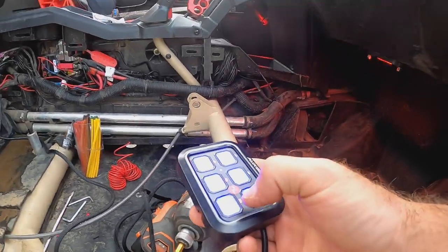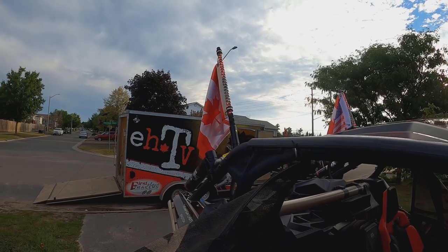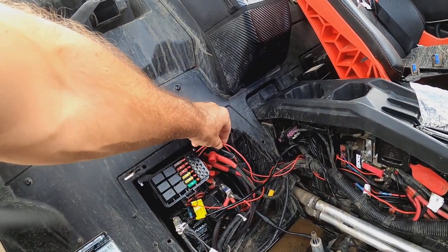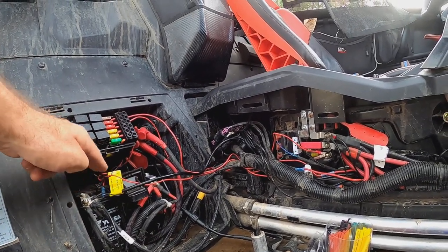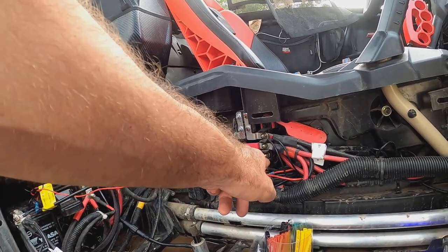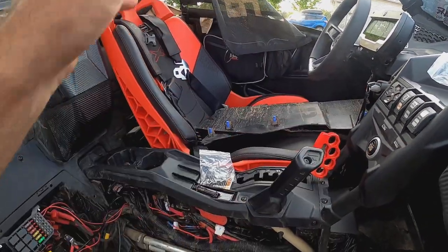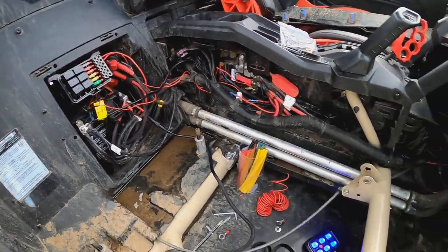We have rock lights? We do. Okay, do we have the halos? We do. Yeah, there we go. Right on. Nice. And so that's all you got there, right? Your gang switch back to your fuse and relay box. Then it's just positives in and run your grounds. And then you just have your ground down here for the block itself, straight to the battery, and then the power to power everything to the accessory. Easy peasy. Really cleans up things as far as having a ton of switches to wire all over the cab and stuff. So yeah, that's a good buy, man. I like it. Right on.